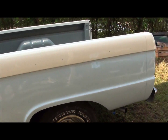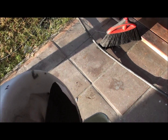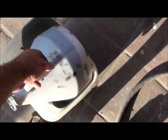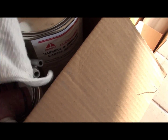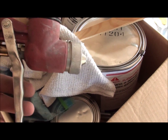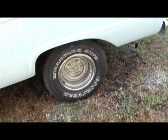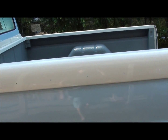I'm gonna let this dry, and basically, when you're doing a hopper gun, you just let this stuff dry in the hopper, and the next day it just peels right out. The only thing you gotta do is clean the gun. Just run some lacquer thinner and stuff and clean up the actual inside of the gun.